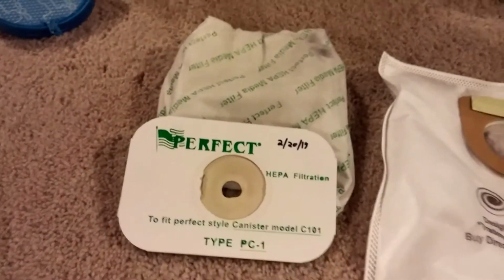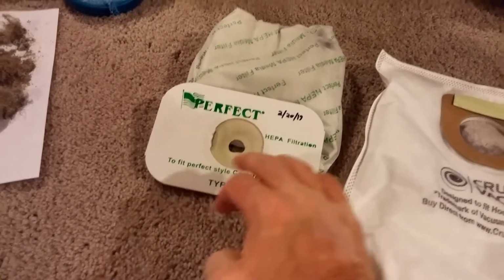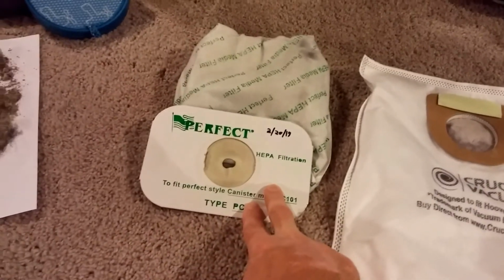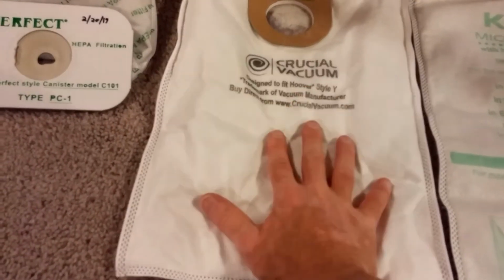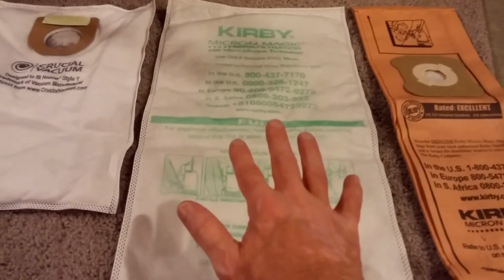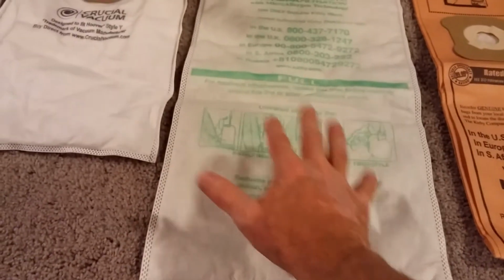So bottom line is, with these HEPA bags, you lose some airflow, it's not very much. So just to recap, this guy full, you lost 7 CFM. Big whoop-de-doo. This one here is a much larger bag, and it loses 15 CFM. A little bit, but so what? This one here, a giant bag, about 20 CFM. So you say, well, wait a minute, why does a large bag lose more CFM? Well, you have an awful lot more area.